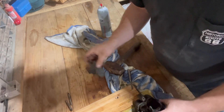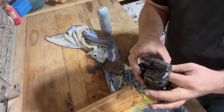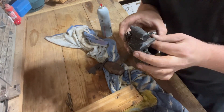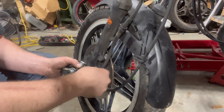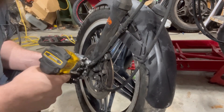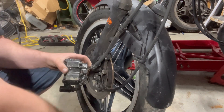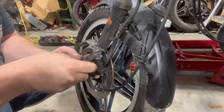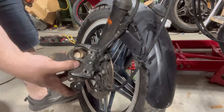All right, let's see if we can pop this out. I don't know if these pistons are going to be savable — they're pretty chewed up. See all the corrosion in here. So we're going to reattach the caliper and use the impact just to get it snug — just tight enough. Throw a couple pads in here to block off one of the pistons from moving. Now we're going to pump that front brake up.